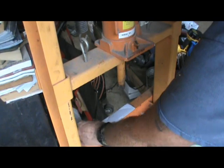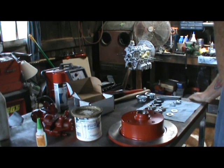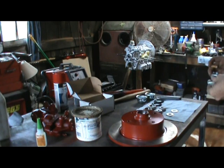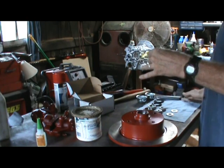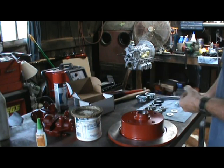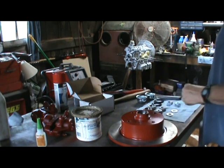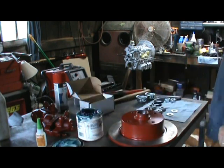We hope folks can actually enjoy mechanics. This kit from AC Industries — I like it, it's a really good kit. They even go so far as to label your axle nuts right and left, because on the driver's side — your left — it has a left-hand thread. Not that you couldn't figure it out yourself, but it's a pretty cool thing that they go and afford you that convenience. Don't get the right and left mixed up.